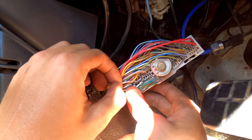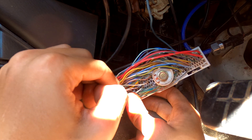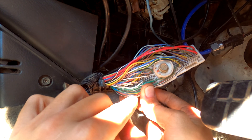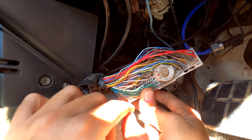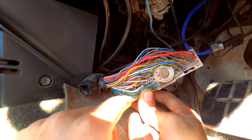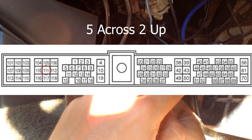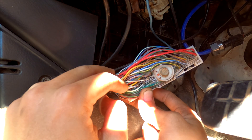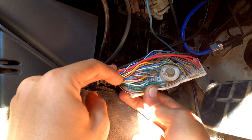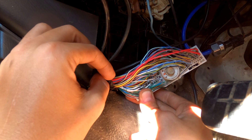One thing I want to add: this wire here is red and white, and there is another red and white wire just above it. So you want to make sure you look at your diagram and figure out which one is top, bottom, left, right, and find the position. Pin 111 is on the left-hand side — it's about five across and two up. Don't go for the one on the right-hand side, that's not it. Don't just go off colour — go off colour and position, or ideally position only.